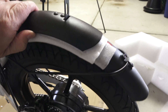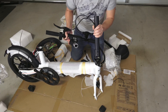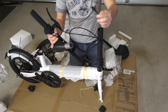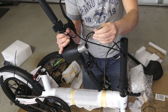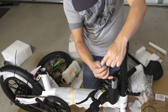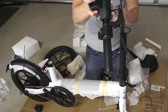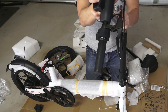You have to take the fender off from the back wheel. Next, I am going to put the handlebar up. All you need to do is just lift it up like so and lock it up. There is a cable here that comes through. Inside this part is also the connector. So I am going to go ahead and connect the two together, aligning the two arrows together so it will go in. You are going to have to kind of shove the remaining wires inside the tube.